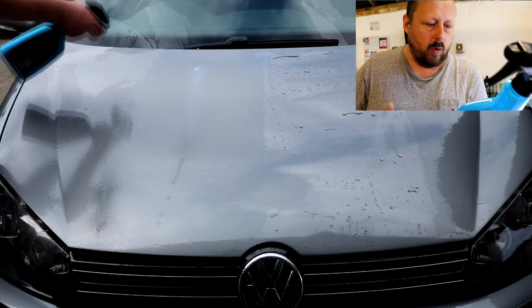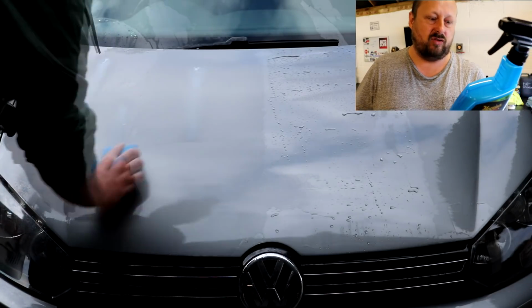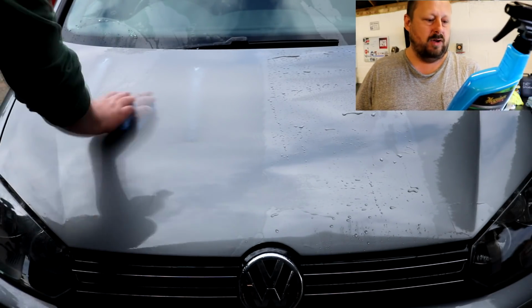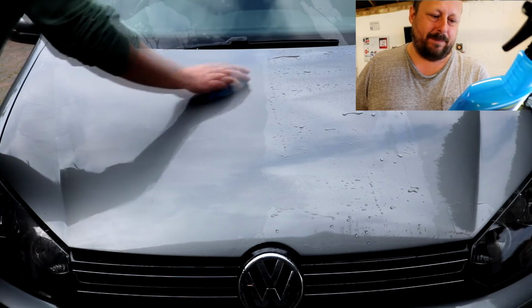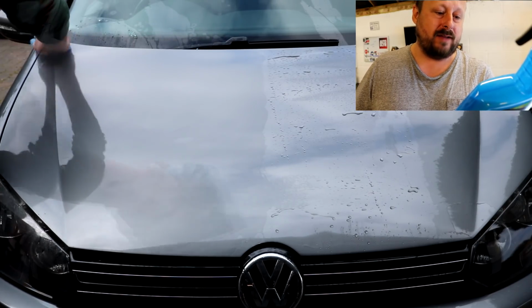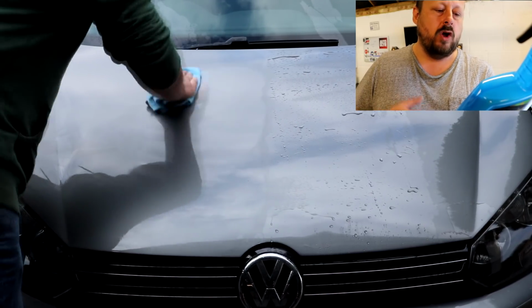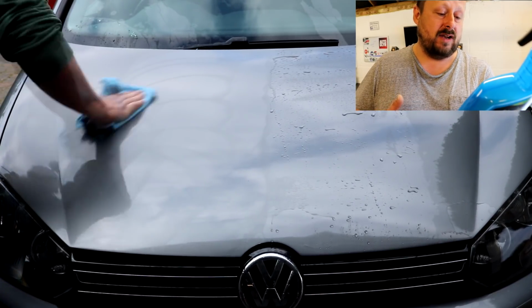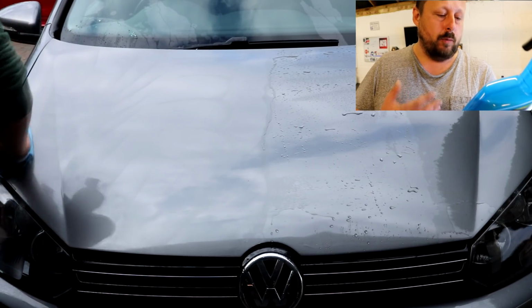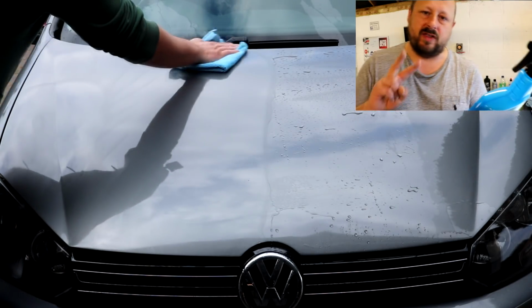After rinsing the vehicle thoroughly of all the wash soap, spray Meguiars Hybrid Ceramic Wax over all exterior surfaces. So that suggests trim, glass, everything, you know, panels obviously, don't miss those. The next step, note, for initial application of Meguiars Hybrid Ceramic Spray Wax, skip step 3, the second rinse, and go directly to step 4, which is using a clean dry towel for the initial wipe. This establishes a foundation layer of protection and beading that will be enhanced with the subsequent product applications using the wash and rinse method. So there are two application methods.